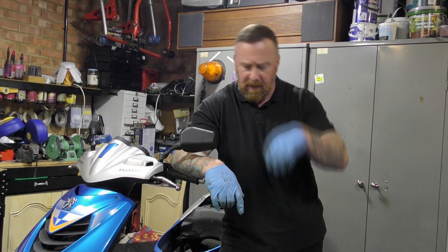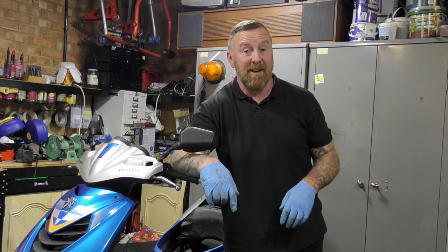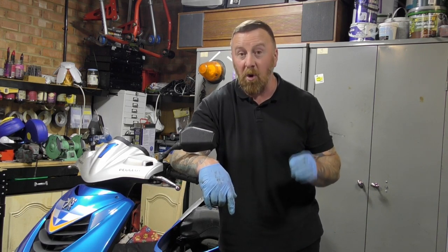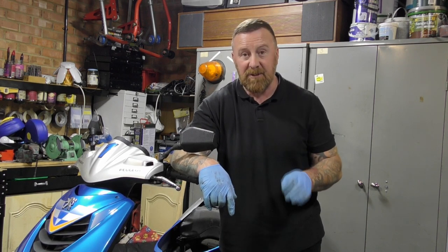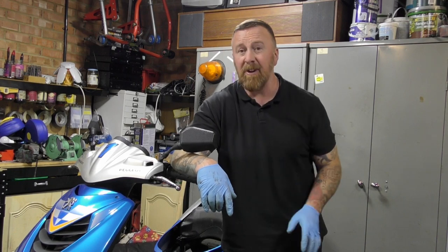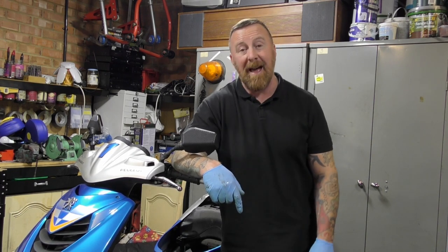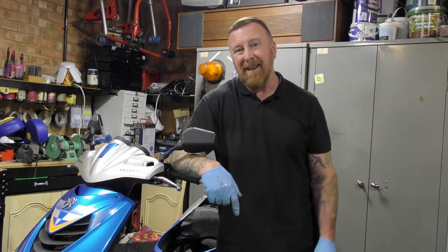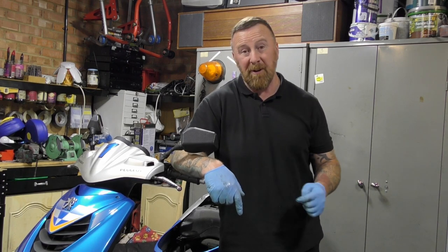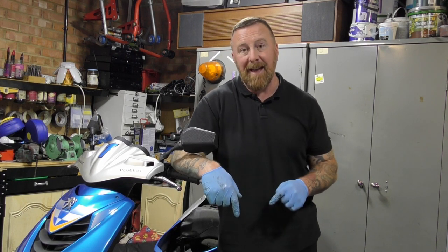I spoke to quite an expert in the field today. We both agree and disagree — E10 fuel isn't brilliant with carburettors, it's been used on the continent for a very long time, they haven't got the same climate as us. But we both agree: E10 fuel left in your carburettor and petrol tank for any length of time will damage it, destroy it. So if you're going to store a ped for a month, drain all of the fuel out and the carburettor — that's the best thing you can do. E10 petrol also goes off quite quickly. Definite proof in the pudding: smaller jet, dirt in there, changed the fuel, better sports exhaust, and this baby's running.